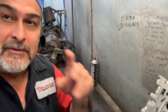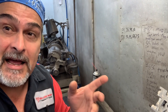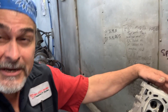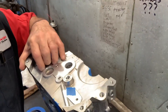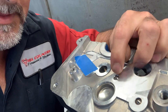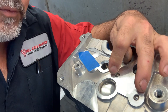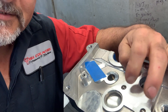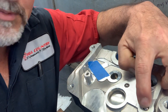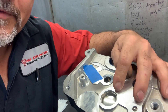The reason it builds up is because of the carbon in the intake ports. So how do you clean that and not get glass beads everywhere inside this head? Here's another issue we have with late-model cylinder heads — see these little ball bearings in here? Those are oil galley plugs. Once they machine it, instead of threading it and putting in a screw-in plug, they drive in these little steel balls that are slightly bigger than the hole, drive them in and they're done — they don't go anywhere.